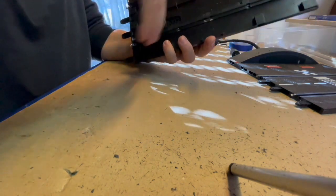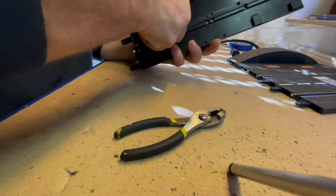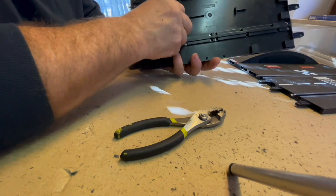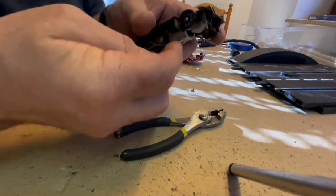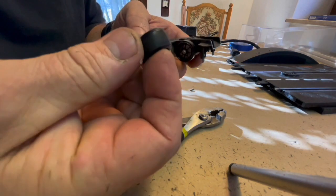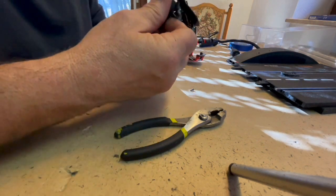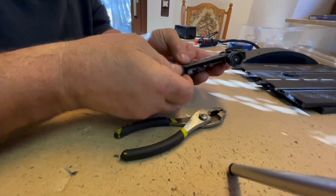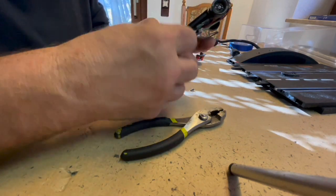For a little bit of time it took to put this together, this tool works pretty well. I could probably use it to true up tires on cars as well if I want — I haven't tried that yet, but my guess is it would work. A little close-up — you can see those lines are gone. The tires won't be bowed out and hopefully it won't make as much noise either. It does seem to give better traction because you're getting the whole surface of the tire on the pavement rather than just the middle.